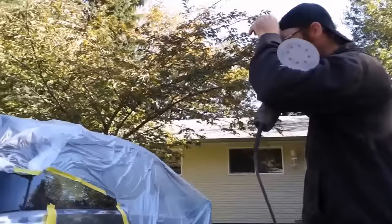Okay, so we're sanding down the third coat. Still using 80 grit, right? Still using 80 grit. 80 grit to a 180 grit, go over it, getting it ready so I can just final putty it. Basically have it all down now. There's just basically pinholes left that'll need to be filled with some putty. Okay, so 80 was first and then 180. 80 was first and I switched to 180 and then I'll putty it and then I'll switch probably down to a 400 grit to go over the putty spots.